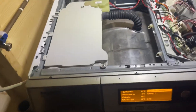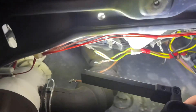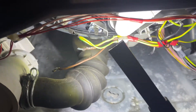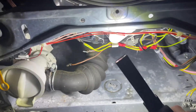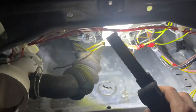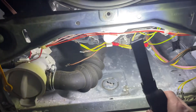The reason for that isn't because of the amount of electronics in it, even though it's got quite a lot to it. It's actually because the washing machine has two heaters rather than just the one. The two heaters make the wash a lot faster — the washes on it are all roundabout or under an hour, not long at all. They have two heaters to heat the water up faster so it can get washed in such a short time.